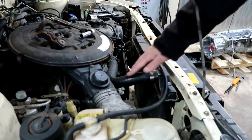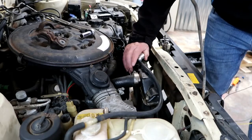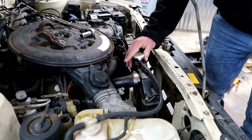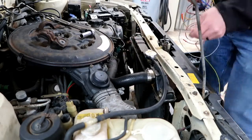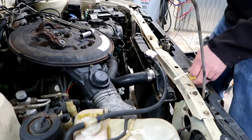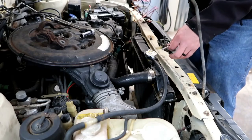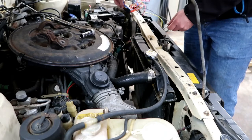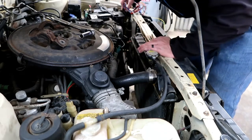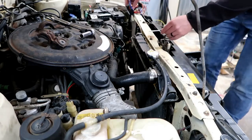We want the probe as close to the hot side as we can. The hot side is right here coming in. Cold side's going out the bottom. Previous vehicle owners mounted the fan kind of on the hot side, so we're going to need to put this as close as we can here. Unfortunately, we want to put it on this side, but this control module really ought to be over by the battery, so that really kind of limits us how we want to do this.